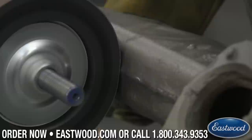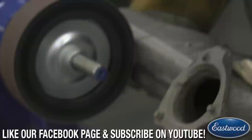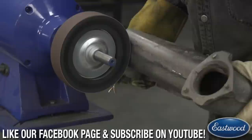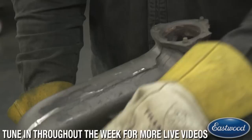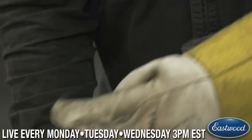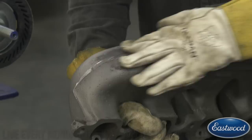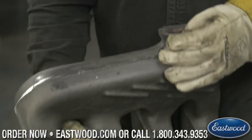I'm going to push a little harder here and just knock this section down. You can see just that section I did — we're starting to get close to flat. Because the expander wheel has some give to it, it's not grinding in and taking out a gouge. It's telling me we're getting darn close to being flat. Once I start seeing that, I know I can keep moving and grind those areas down. This big section is getting pretty close to flat. This is a cast iron manifold — usually a pain to do.